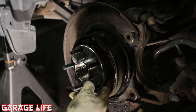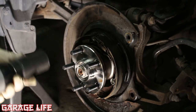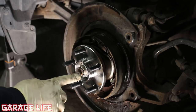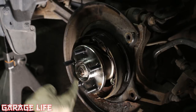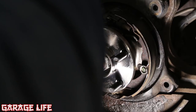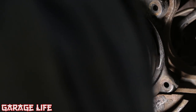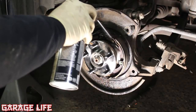We've got all four bolts holding the hub on. Now we'll reinstall our axle nut — get your impact and give it like 30 ugga-uggas. These don't take cotter pins; what you need to do to lock it in place is get a screwdriver right here at this notch and hit it to notch the nut so it can't back out. You can use a flathead screwdriver or some kind of punch for this.